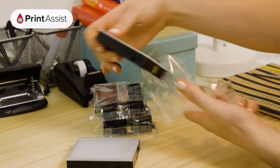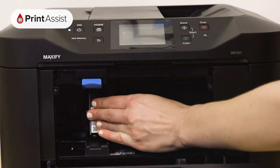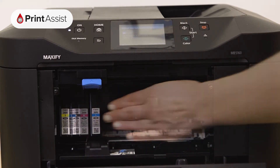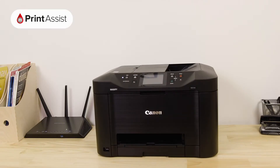In no particular order, you can remove the ink tanks from their wrappers and place them into their corresponding slots. Each ink tank will fit into place with a discernible click. When you're all done, close up the printer. You'll then hear the printer making a few noises while it gets itself ready for action.